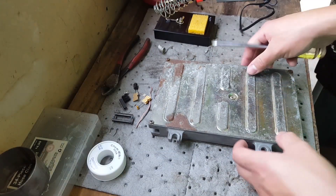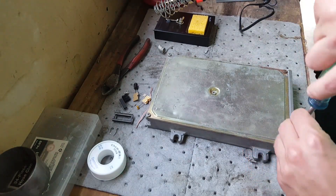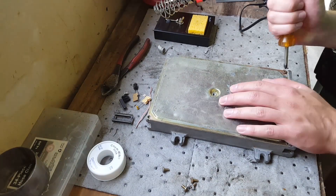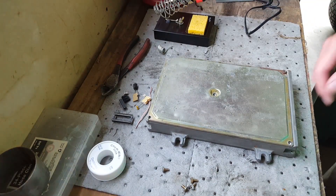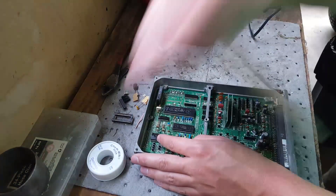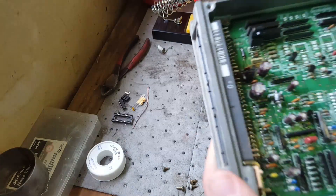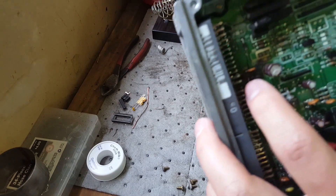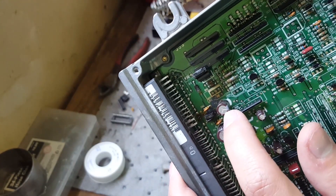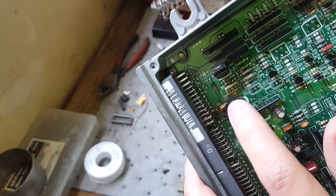Next I'm just going to go ahead and take this ECU apart. This one's too rusty to get off, so luckily I have a fix. Upon taking this apart, I did find a part that's bad — this is completely burnt up. I'll have to find out what that is and replace it. Here's the main capacitor — I'm going to replace that right now. The ECU seems to be working regardless, so I guess I'll just try to use it as is.